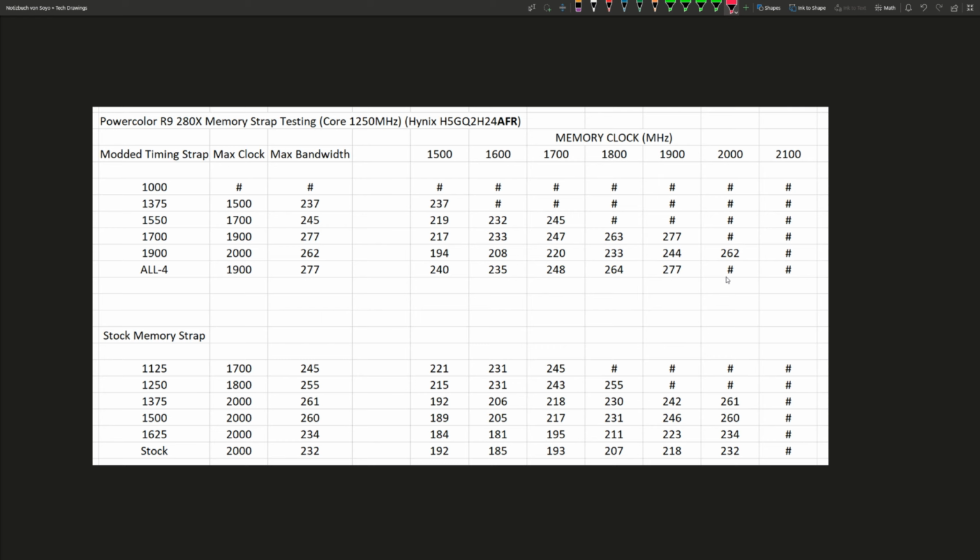So the memory wasn't getting anything special. If I ran the card on water, I would have direct airflow over the memory chips. In this test setup, I had airflow through the Morpheus, which is a pretty thick heatsink, to the memory chips. So they did get kind of hot. Cooling them down could help. I haven't tested AFR for cold scaling really.